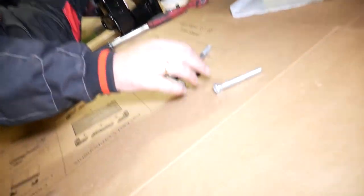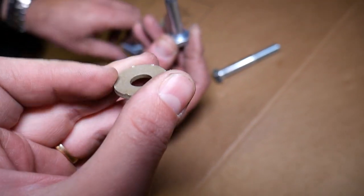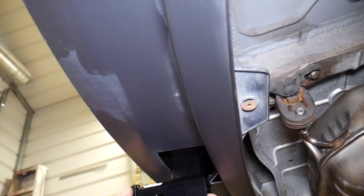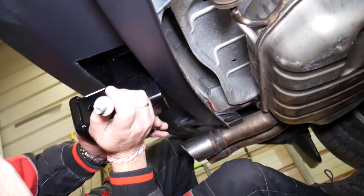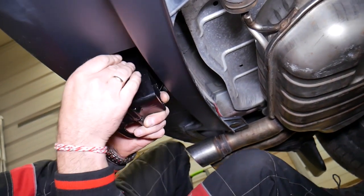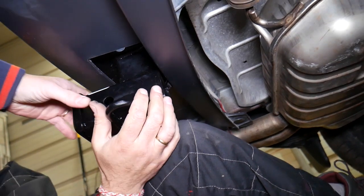We're ready. We've got the hitch, four bolts, and four washers. Check the teeth on the washers — always consult your manual because things change, but the teeth should face the frame of the car so they won't back out. We have everything ready. The hitch goes in at an angle. The first two bolts you catch will be the hardest part — because the hitch is a bit heavy and you need to find the hole. Once you catch two of them, everything gets a little easier.